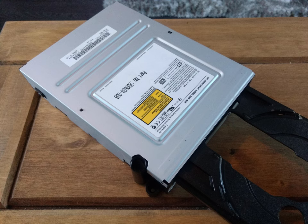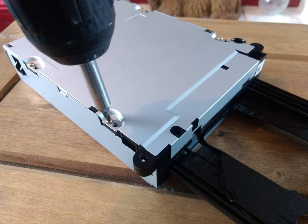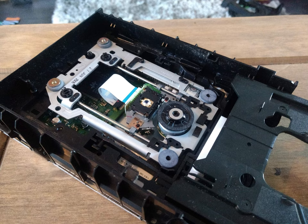With the drive now free from the machine, just unclip it from its plastic cage. Flip the drive over and you'll see four screws. This is on the Toshiba Samsung drives — the Xbox did use a couple of different models and some have screws on the top instead. Whether they're on the top or the bottom, take those four screws out. Once the screws are out, lift off the top metal casing to see the drive innards. Then push the drive tray slightly back in to reveal the drive wheels and where the belt is attached.